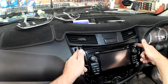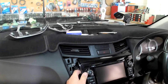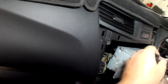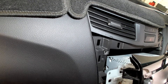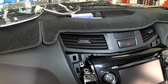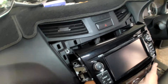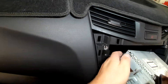Now that the six screws in the plastic and the four screws in the metal have been removed, that should just pop out. It's a bit of a tug to release the clips and this whole thing will slide forward. I'm going to release the climate control plug first — if somebody's put something else in here, there's not as much slack as there would normally be.